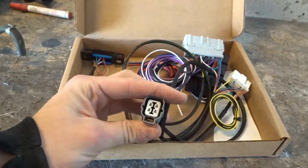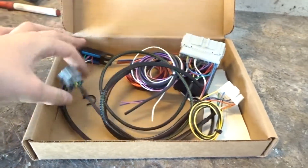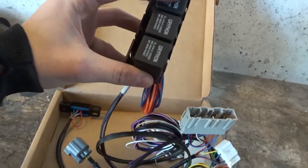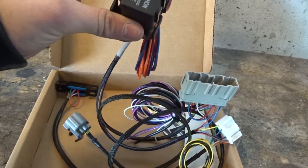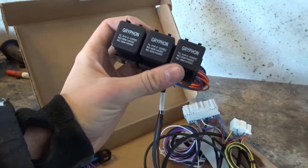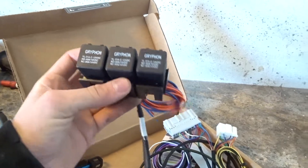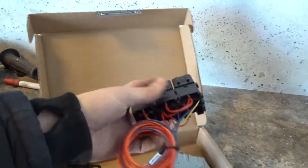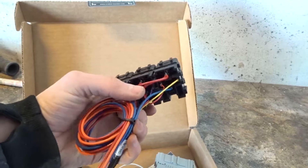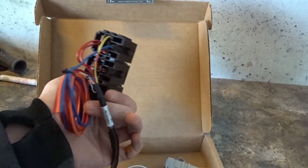This is your oxygen sensor in your exhaust. I don't have one yet, so I have to make it or buy one. This one plugs right in. This one plugs into your ECU. And these are probably the fuel pump relay, main relay, and something else — I'm not sure yet. Probably a starter relay, but I'm not going to use the starter relay because the starter is one big relay, so it's not really necessary. These are wired already, so I have to figure out some things because the main wiring loops back towards the fuel pump — I have to see which gets power and which doesn't.